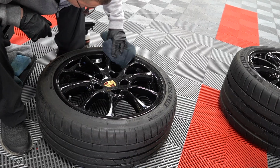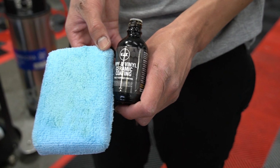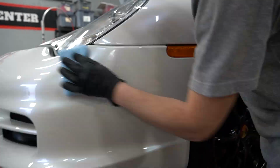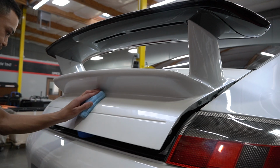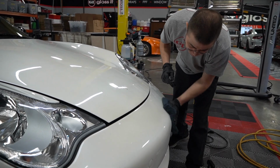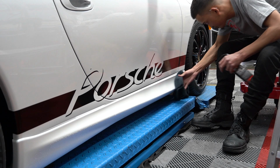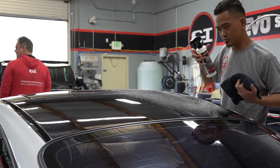Now, for the PPF on the car, we have developed and engineered a specific ceramic coating that helps with the oxidation that can happen in the glue. When applying PPF, people think it's the film that turns yellow. It's not the film, it's the glue. It's the UV that oxidizes it. After testing this for the last 8 or 9 years on many of our own cars that we keep outside in this brutal summer weather, hot weather in Las Vegas with extreme heat, we found that it slowed down the oxidation of the glue. This is a great alternative if you're looking for something to prolong the PPF. It also cuts the rash that you can get from pitting from the road.